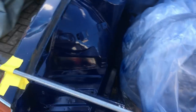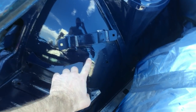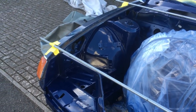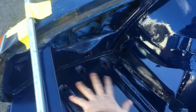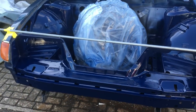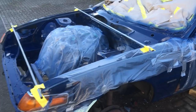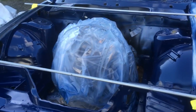There's one big screw-up which is over here. When I was painting, I sprayed this bit and loads of water ran out because I hadn't dried this area off. I've learnt from suggestions in the comments that I should have really dried it out after wet priming it. Didn't know that — you live and you learn. This whole area was quite rusty and I rubbed it all down and painted it, but really I probably should have done some oil prep. I've had a lot to do and not a lot of time. When you add it all up, it isn't a body shop job — it was never going to be. It's blue and none of the paint's fallen off yet, so I'm actually realistic and quite happy.